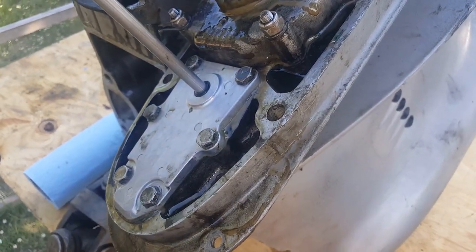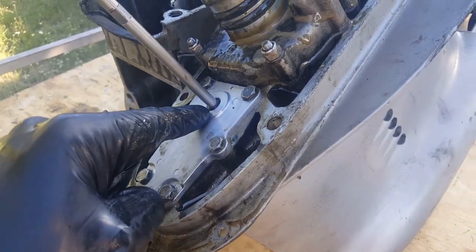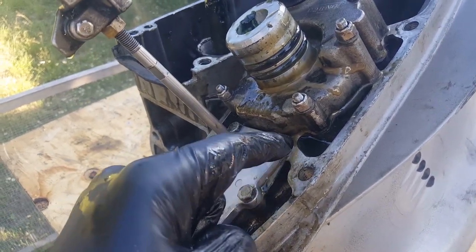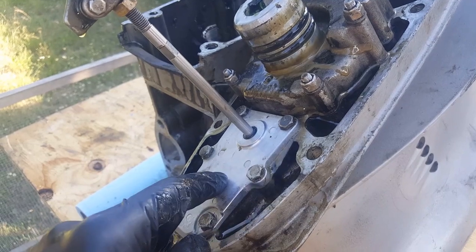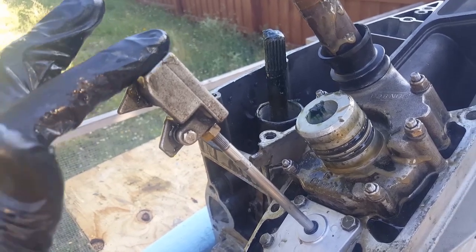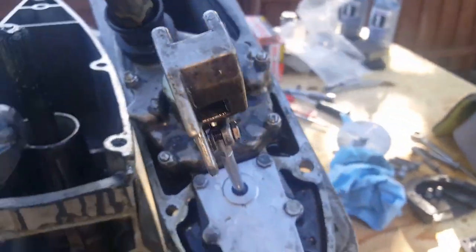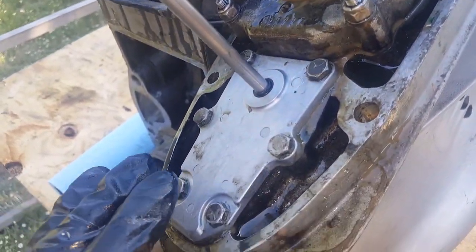So here's your shift rod cover. When you're measuring the height of your shift rod, your overall measurement isn't from here and it isn't from here as you would imagine — it is from here. Not necessarily from right here, but from the base. If you do it from here you're wrong, if you do it from there you're wrong. Also the top part is measured from up here, so keep that in mind. Don't measure from inside here — you're going to be measuring from the very top.